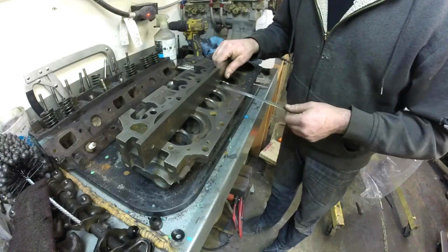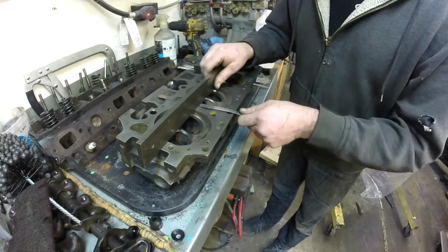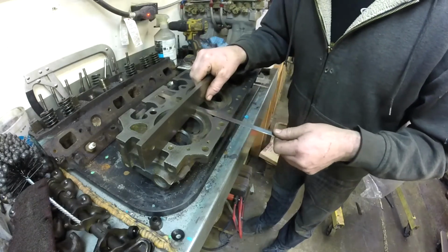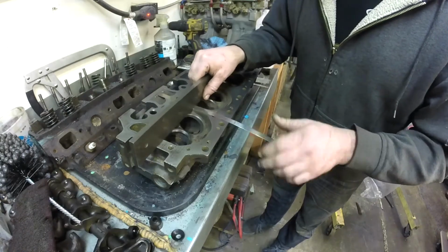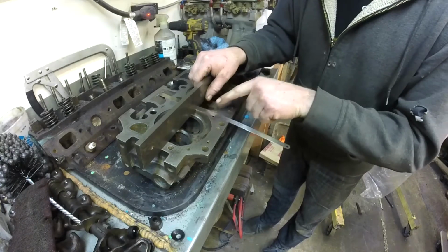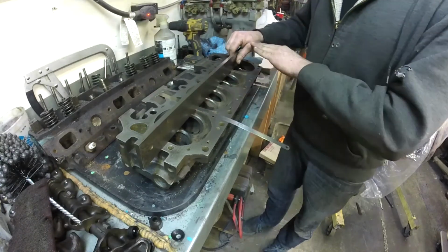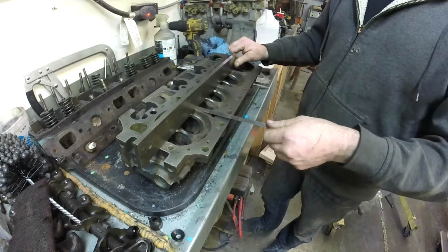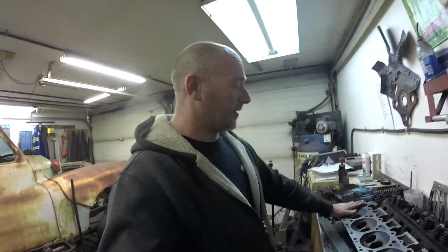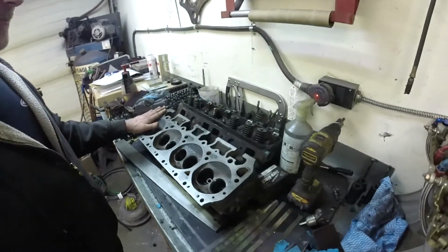Okay, I've got even drag for six thou. It's probably actually six and a half thou. Okay, the six will move, so I'm gonna say five and a half thou, six and a half thou, four thou. You can see we've got an inconsistency on our surface. So I'm gonna get these heads milled 10 thou,